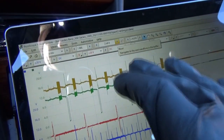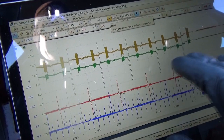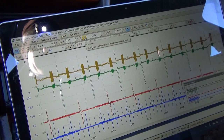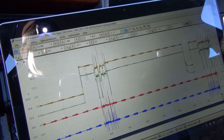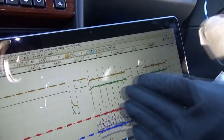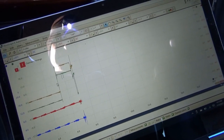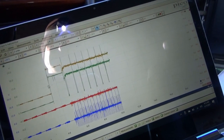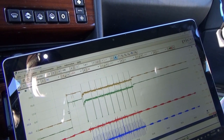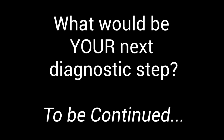Sometimes you get some kind of weird stuff on the control wire — it's not dropping all the way down and firing like you'd expect. But then other times you crank it and there's absolutely nothing. That crank right there it started doing something all the way through, and then on these cranks it doesn't — go figure. Let's just see what happens without the cam sensor plugged in. It still fires the injectors but not the spark. The weirdest thing.